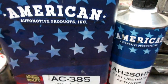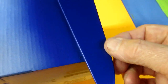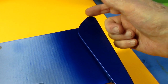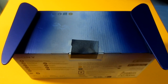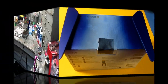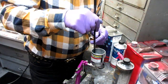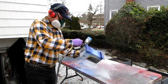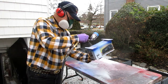Two coats of clear, about 20 minutes apart, and put it in the garage. This is the clear we've been using - thank you Joe Padula, this is the leftover from the Ducati repair. This clear has worked very well and buffs out easily. A good indicator if the material is ready for the clear: it's not wet to the touch and it's dull. The clear is then going to make it nice and shiny. I want to be careful to get the edge so the light shines right along the edge - that's one of the features I like about these parts. It's a four-to-one mix. Anytime you're using anything two-part, a mask is an absolute must.